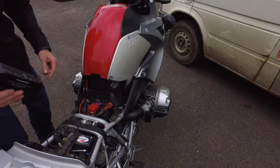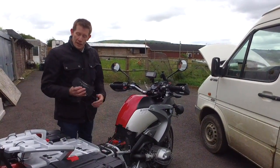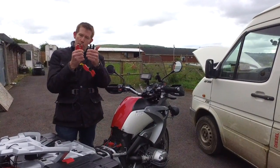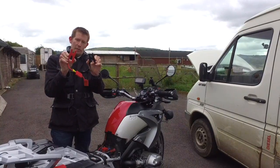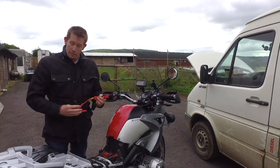I've had an issue with this before. I did have a flat battery when I went to Wales, and the problem was that because the battery is sort of recessed down there, I couldn't get the clips properly onto the battery. That's one of the problems you can have with these units — you need a very good connection, as with all jump-starting.